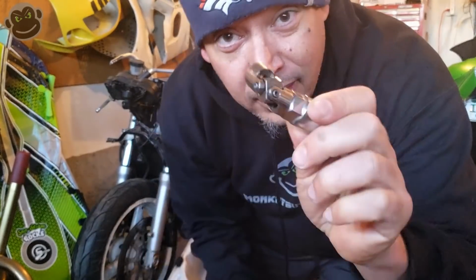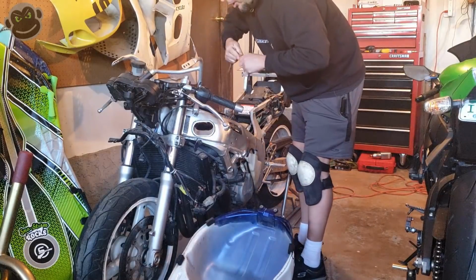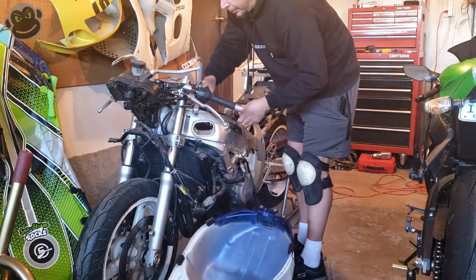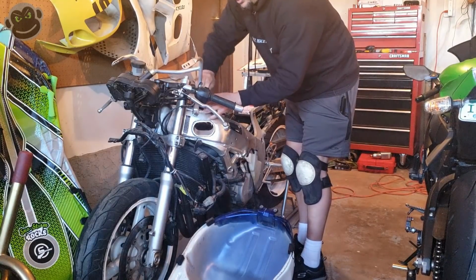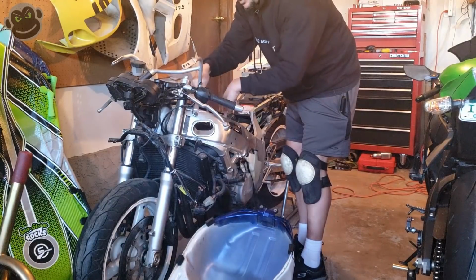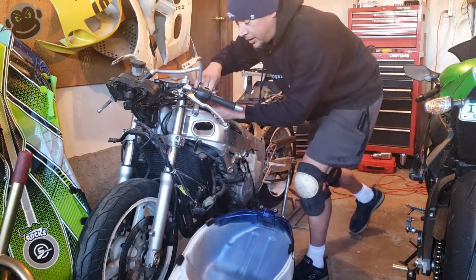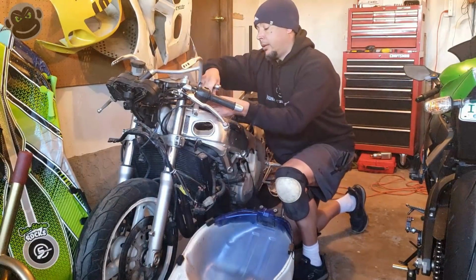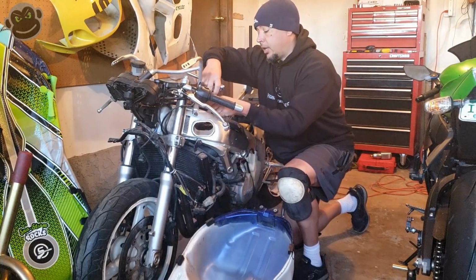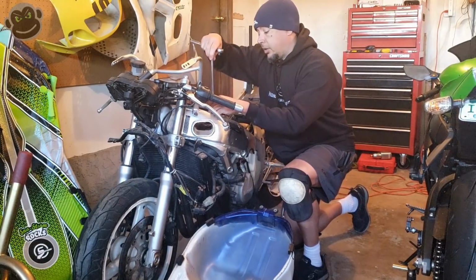Universal joint. They're pretty handy. So the spark plug for the number 1 cylinder is at an angle where the extension, and I'm using a pretty long extension, actually hits the frame. You can't get in there straight. So, details that you forget after 15 years. So use a universal joint. Makes it a lot easier to get it out. My goodness, it's chilly in here.